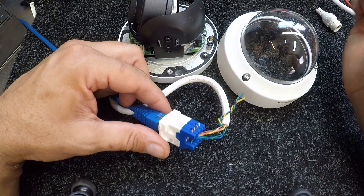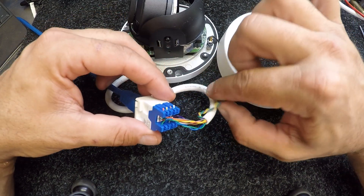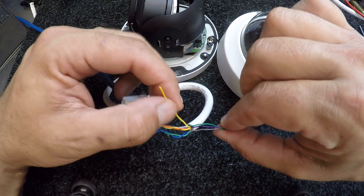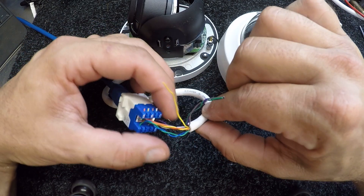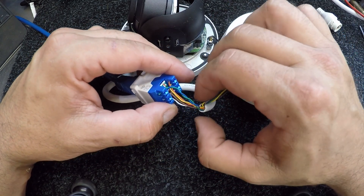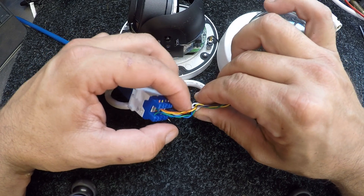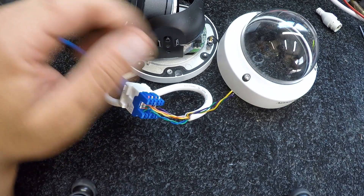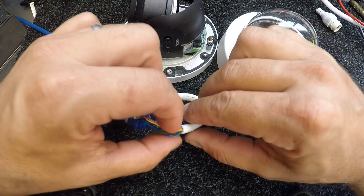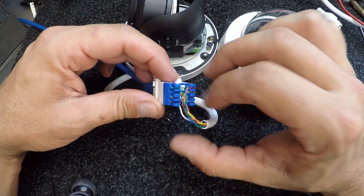There is a tech bulletin released by Hikvision a couple of years ago that details their cable pinout. You'll notice a couple of the colors are doubled up and some have traces on them — for example, there's a yellow cable and a yellow cable with a silver trace. Where cables are paired up in a twist like that, I just use them together. There are also two lots of power wires that I normally cut off purely for convenience and tidiness — they're surplus to requirement and won't short or cause any grief.